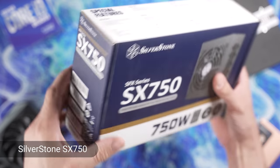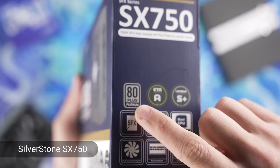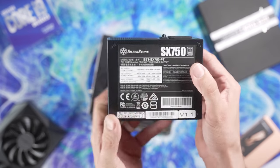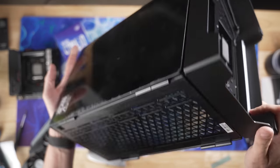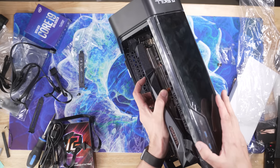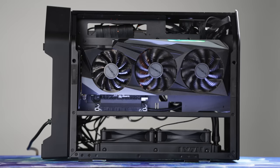The two main components I actually acquired are the 10850K, which I bought for my dad's build, and the 3080 Ti. Powering the entire system is Silverstone's SX750 — a 750 watt 80+ Platinum SFX power supply. It's mini, but it can deliver 750 watts, and we're not getting anywhere close to that. It's also remarkably efficient at 80+ Platinum, so I don't have to worry about power draw. The build process went remarkably smoothly. The Z5i is actually pretty great to build in. You just take off the tempered glass side panels and everything is obviously laid out — motherboard spacing, power supply spacing, and on the back side the GPU. It helps make it so the GPU has its own thermal area, and the CPU exhausts out the back where the 240mm AIO is mounted.